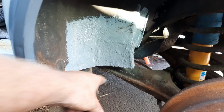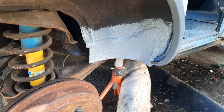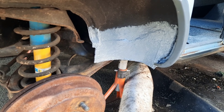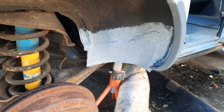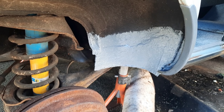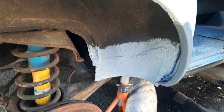Well that's been quite a bit of a day — got the welding done, it hasn't rained which it was forecast to do. This side was a quick easy one, literally just that square patch there, got out of the rot earlier on and then on the inside just clean it — wear the rust in the corners, it's only surface rust, much like the inside of the roof on the old one. The other side was a bit more in depth as you saw — the box section, bottom, back and everything had all gone on this corner. However it was a pain to get at because the suspension and the chassis are in the way, but I managed to weld it and replace it from the inside, then seam weld inside and then get to the outside and tack it in various places, which has helped it be solid. It'll all be covered in black wax once this has dried properly.